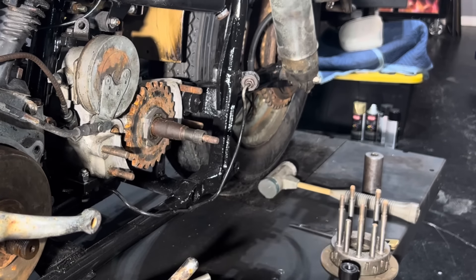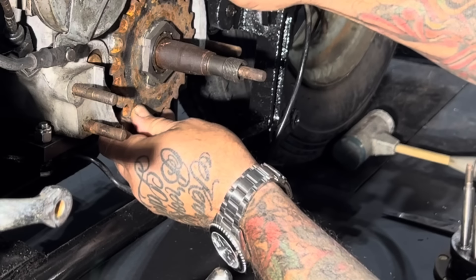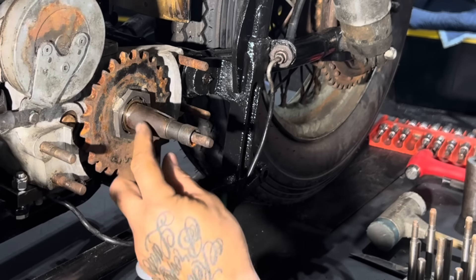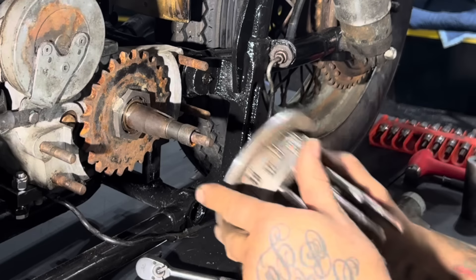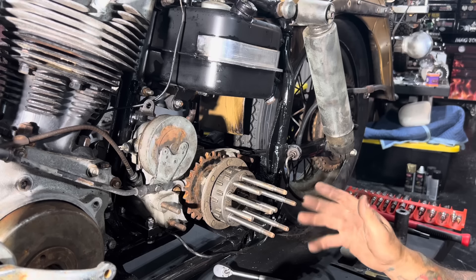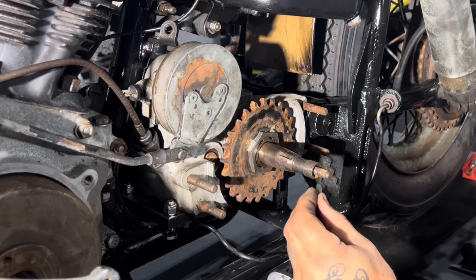That sucker's on there. If you can see how that sprocket and main drive gear is moving relative to the shaft - that's going to be my oil leaking problem, something I've got to fix pretty soon. Okay, so this is called a Harley-Davidson four-speed tapered shaft. Later models had a spline shaft instead of a taper, but you can see the shaft tapers down. There's a male taper here and a female taper on the clutch hub. You use a woodruff key to hold everything in place, and the force of the clutch hub nut forces the clutch up onto the taper.